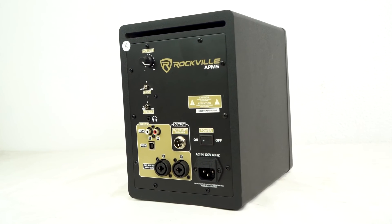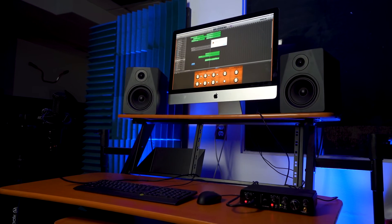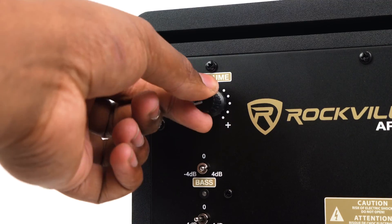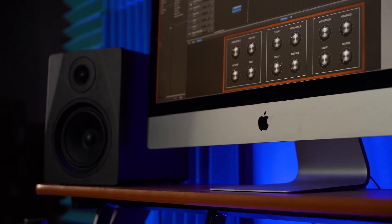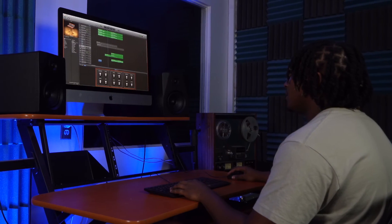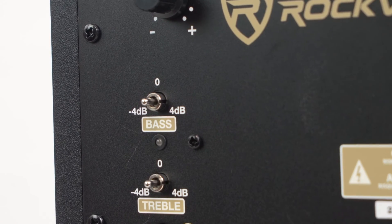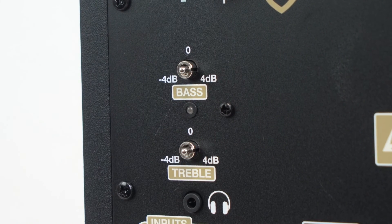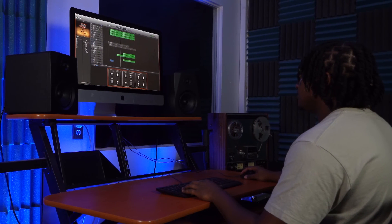On the back of the powered speaker are all of the controls and inputs and outputs. At the top there is a volume control to set the level of the system. If you are using these studio monitors with an audio interface like our R-Track 2x2 or the Rock U Mini, we recommend setting this volume knob at around 75-85% and then adjusting the overall volume from the interface itself. You can also keep this rule if you are plugging directly into a computer or gaming console, setting the speakers at 75-85% and adjusting the master volume from your TV, console, or computer. There are also bass and treble three-way switches that allow you to cut or boost the treble and bass independently by 4 dB. These adjustments are totally dependent on your speaker position in your room, and we recommend setting them to whatever makes your speakers sound musically flat so that you can get the most accurate sound out of them.